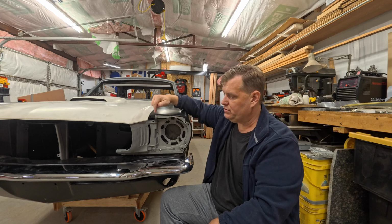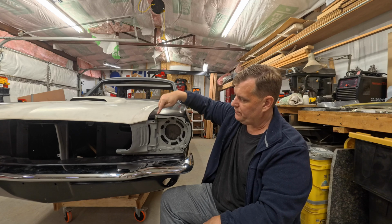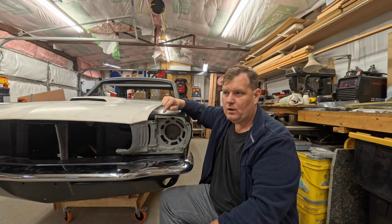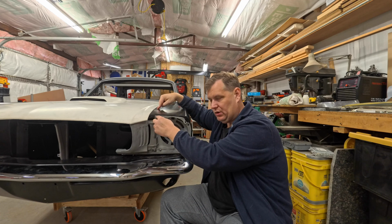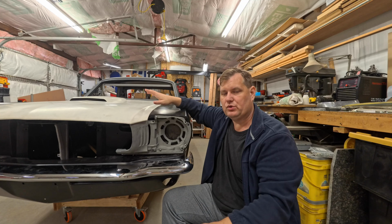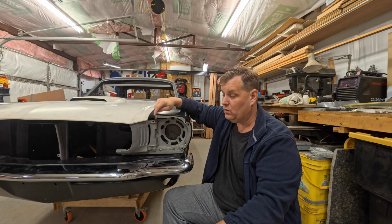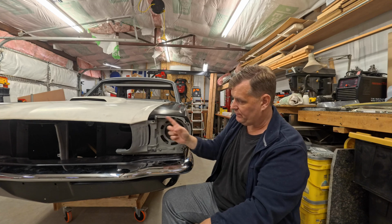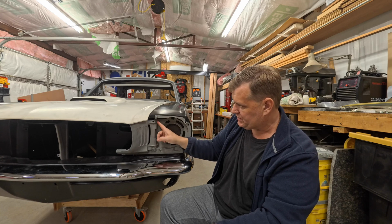What you don't want is a connection where you go from, say, the screw to the fender to this. You want to have that isolated as much as possible, so that if you put a voltmeter on there, you don't want all these things to be conductive to each other. I know that's asking a lot, but you do your best to minimize it, and that means good coatings on everything, including the inside of the hole, and so on and so forth. That is something you run into up north when all this stuff corrodes out, and that's just galvanic corrosion.